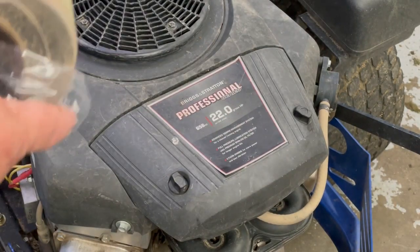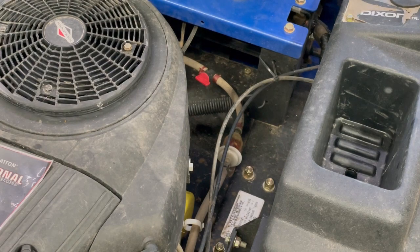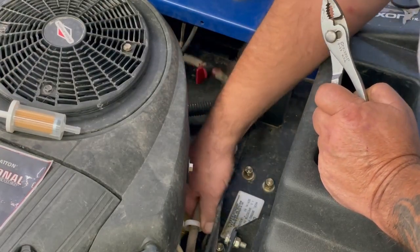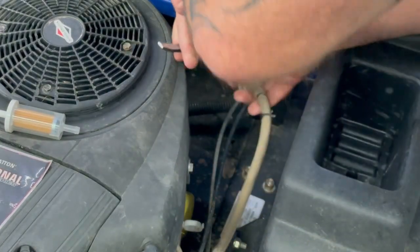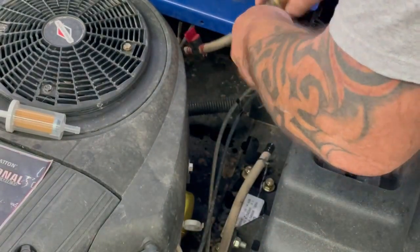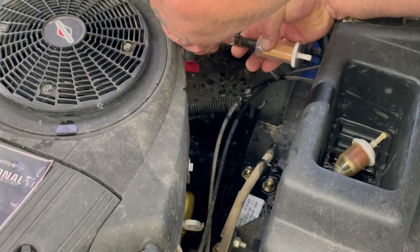While we're letting that oil drain, I'm going to put a new fuel filter on it and I'm probably going to put new plugs in it too. There's a fuel filter right there — on these Briggs twin cylinders I like using these OEM long inline filters. So go ahead and turn the gas off, pull the hose out of these clamps, and take back the clamps. On these filters they got an arrow on them — the arrow goes towards the way the fuel flows to the carburetor.